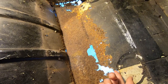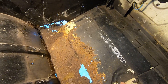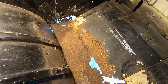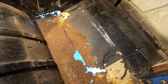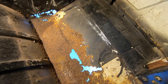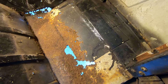This is an access panel on the FC, so there are some screws here and this just gets tucked under. I'm going to take that out and keep it as a template because it has my dimensions right here. Then we're just going to start removing metal back to where we have good metal to weld to. My new motto is just cut back to where there's good original metal, just enough to weld to, and leave the rest. It's also really going to help you with shape and form and fit.